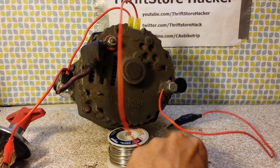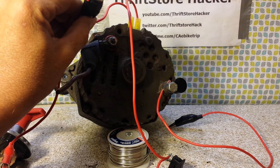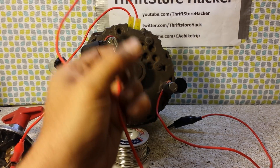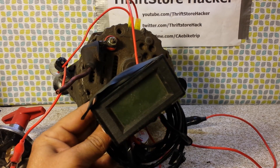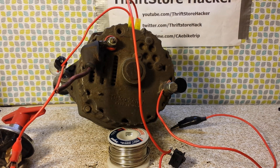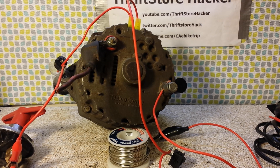While this switch is off, since the alternator won't be charging and there's a problem with the charging system, this light will come on — so whenever this light is on, we know the system isn't charging. As soon as we get it going and kick it on, this light shuts off and it starts generating power. I decided the way I'm going to measure the power on the go is with this battery voltage digital gauge that I got off Amazon for about ten bucks. It's been really handy and we can wire this into the unit — just plug it straight into the battery and we can see how many volts we have. That should be the whole setup right there.